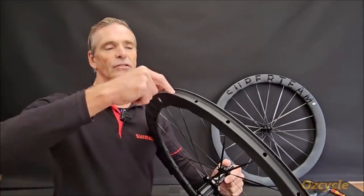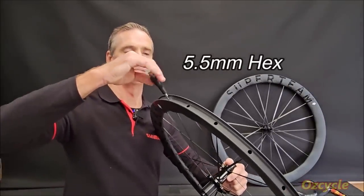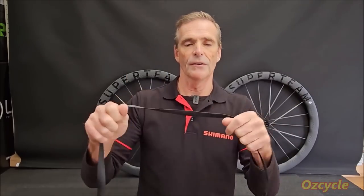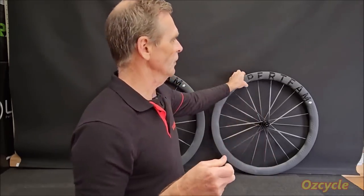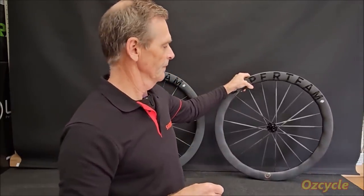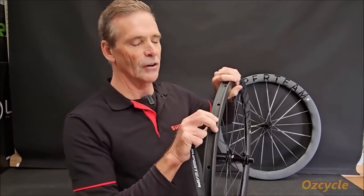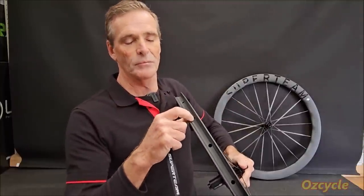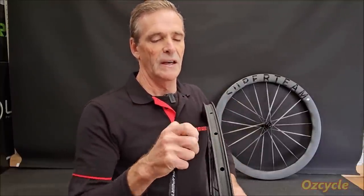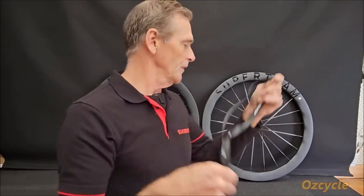For truing the wheels, access is through the hole in the rim with a five-and-a-half millimetre socket. The rim tapes are quite nice at the join — they're strong and not too thin. Because if the tape is too thin, it's going to sink into the holes under high pressure. If you pump your tyres up to about 90 psi, a thin rim tape will press inside those holes, can split, and then you get a puncture. These are not going to allow that — that's fine.